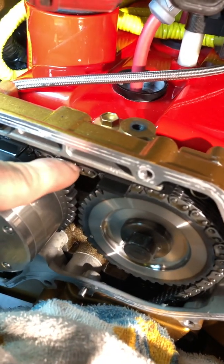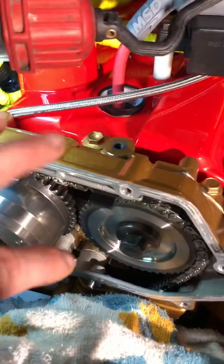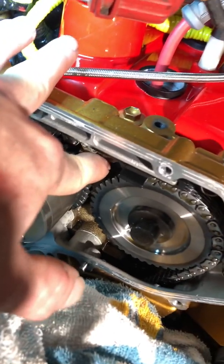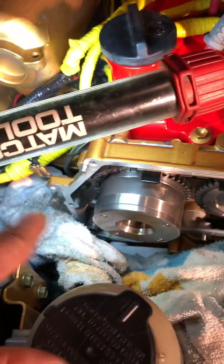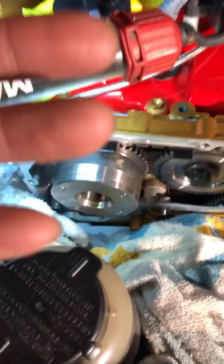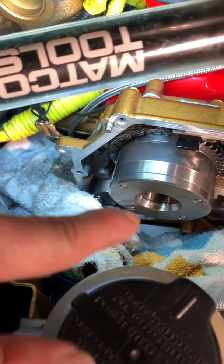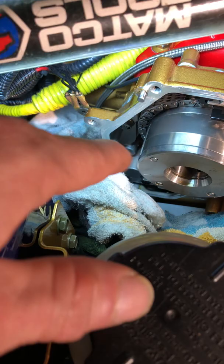There's still some play here. I just took this cover off and didn't touch or move anything — this is from the last time I drove it, about a week ago, and I guess that's kind of normal. But as soon as you crank the engine, the timing chain tensioner plunger should have already popped out and collected all the slack as soon as possible before the engine cranks.